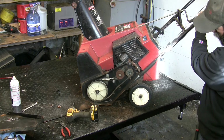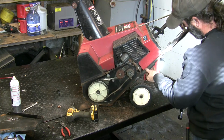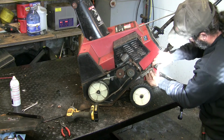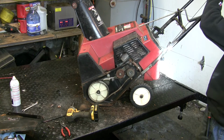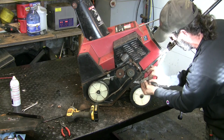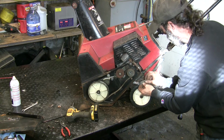So you pull the handle and it tightens up that belt, tensions it. And to adjust the tension, I believe there's a set of, oh, there you go, set of holes here. You could just basically unhook the cable at the handle end first. And you can tighten the cable. Basically, you just move it down a hole to tighten the cable up. We're going to give it one tighter on the adjustment.